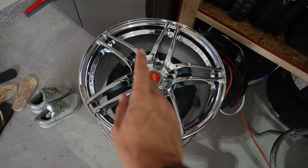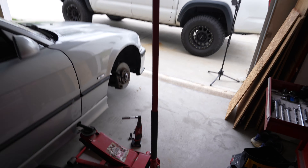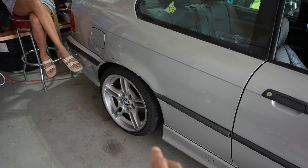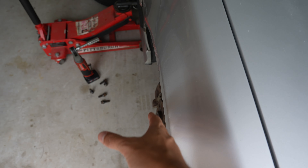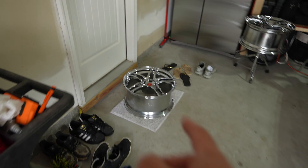I just had the plus 35s on the front, but I'm actually gonna run the plus 22s in the front because they're more aggressive. In the rear — if you know about E36s — it's kind of hard to fit a big wheel on the stock body. I already thought the plus 35s were poking out a good bit, and the plus 22s are definitely gonna poke out more. This is without an adapter, so keep in mind that if I ran adapters it would stick out like 14 or 15 millimeters more.